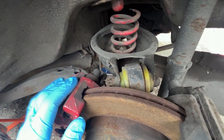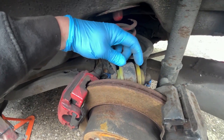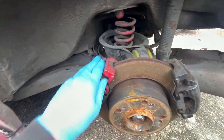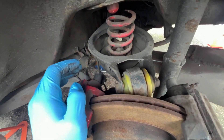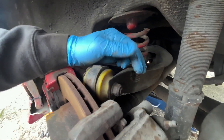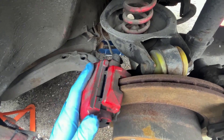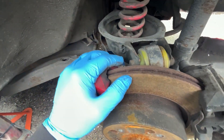So I've jacked the car up. I can see I've got the dual caliper setup on here - that doesn't look too great, I might want to do it up a bit more. I'm going to have to undo this and take the handbrake caliper off because when I did it I didn't think about how this bolt needed to come out. I've got to take it off, spin it around, and go through that way - the original caliper position is in the way, so this is going to have to come off.